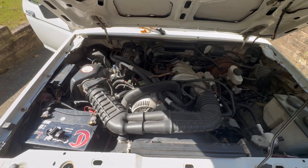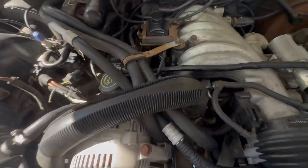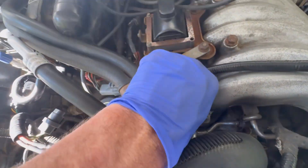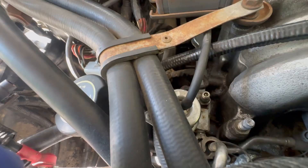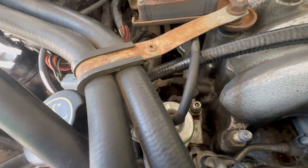The first thing we'll talk about in this car is fuel. An easy way to know if you're getting fuel is, because down in here you should see a little Schrader valve. It looks like a bicycle tire valve. You need to pull that off, stick a little pick tool down in there. If fuel sprays out, then you have fuel.